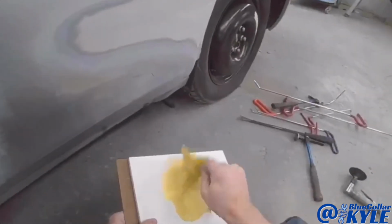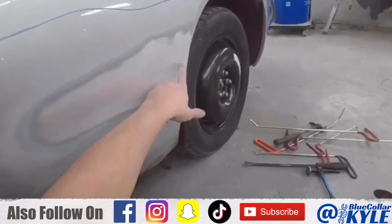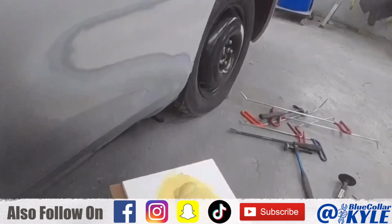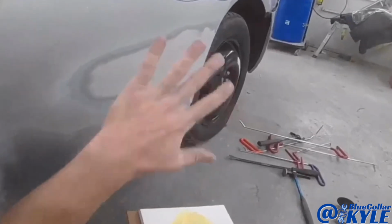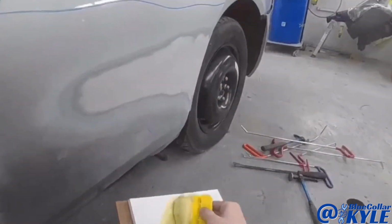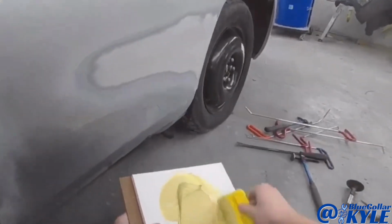Alright, this metal straightened out pretty good. This side came out really good. Still a little in right here, but not a lot. I know from experience if I keep on trying to work it out, it's going to get loose. It's going to tin can on me and start being stretched out and start bouncing back and forth. So I decided to stop messing with that one little spot. But it came out pretty nice for the most part.